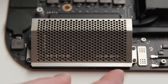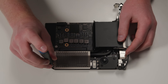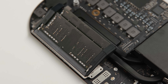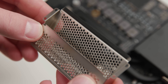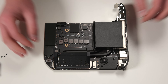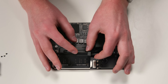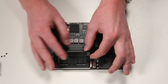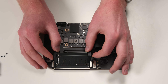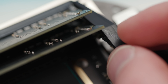Now for the RAM. There are four screws holding this panel in place — very small, Torx 4. This weird shield slides off diagonally. I honestly don't know why this is there; I guess it's to protect the RAM when sliding the motherboard in and out of the case. And there's a little rubber gasket on the side that you have to remove — and that is actually not just a rubber sleeve, it's the RAM retention clips. As soon as you pull those, the RAM releases. That is an odd design. The DIMMs just come out super easy.